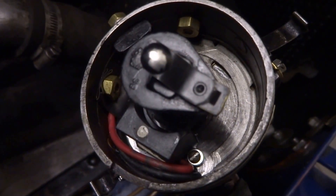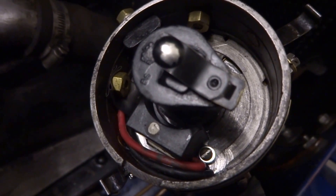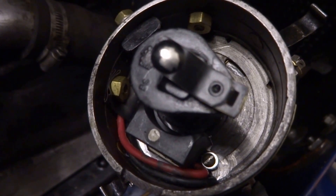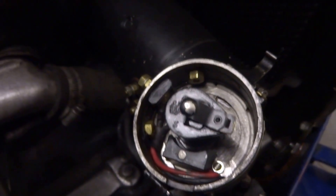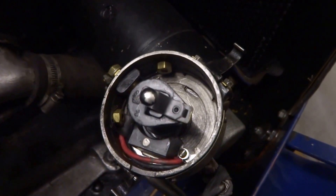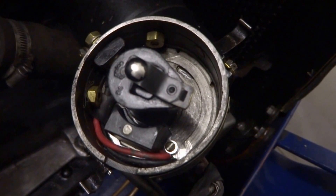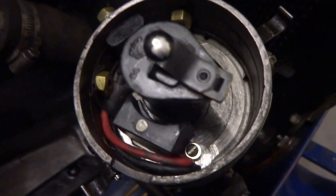There's my finished unit in the car. Before I put it in the car, I actually did a bench test — I took the coil off, the battery out, the distributor, the plugs, and had them all firing on the workbench, because that's far easier than doing it in the car. That way I could gauge where number one cylinder was going to fire, because it's always nice to have number one on the top left-hand side. Doing it on the bench, you can just twiddle the end of the gear on the distributor housing and you get some nice cracking sparks — and some good shocks too if you're not careful. It really does kick like a mule, this device.